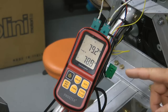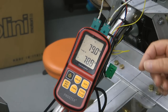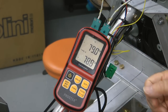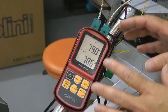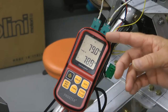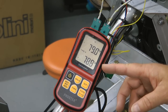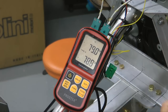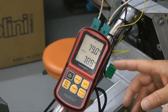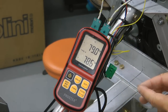Notice the readings are extremely close at rest, which is not bad considering the fluid inside of the engine has stabilized and is very close to the temperature inside the exhaust manifold — a good confirmation the probes are working properly. It's about 80 degrees in this room. But with the engine running, water temperature should be no more than the boiling point, and exhaust gas temperature we'd expect in the 800–900 degree range Fahrenheit. When we ran the engine, the numbers were way off — water temperature was way up into the 200s and exhaust gas temperature was really low.